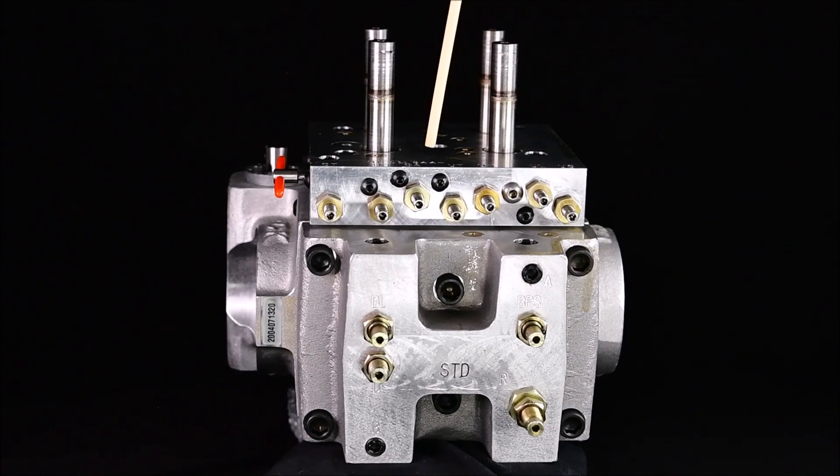On the down side: down accelerate is in for smoother, out for firmer. Down stop is out for firmer — rarely do you need to go in to make it smoother. DT is out for smoother, in for firmer. And manual lowering on the side is counterclockwise to lower your car in an emergency.